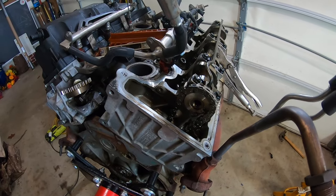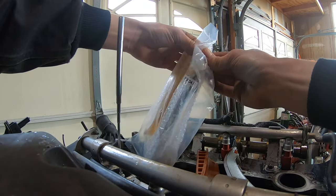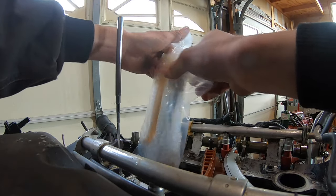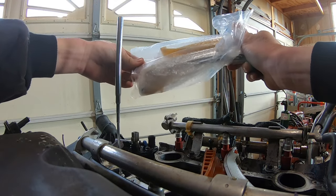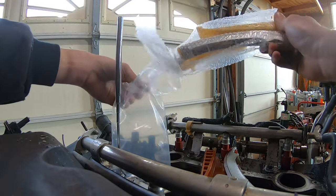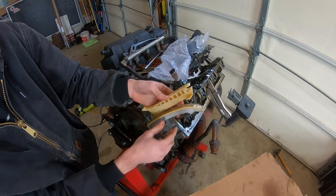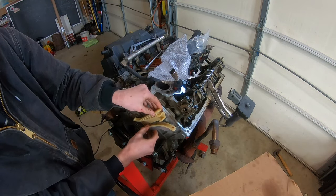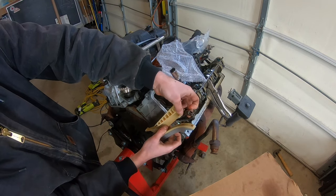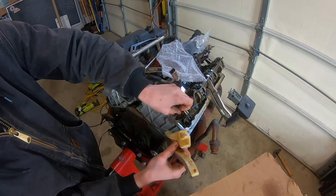Now I'm going to grab my new cassette. Here's my new guide piece — I get them on eBay or Amazon; I'll leave the link in the description below. It usually runs about $20, not that expensive. We need to fish it down into the cylinder head, being mindful that the chain goes in between the nub and the slack portion.